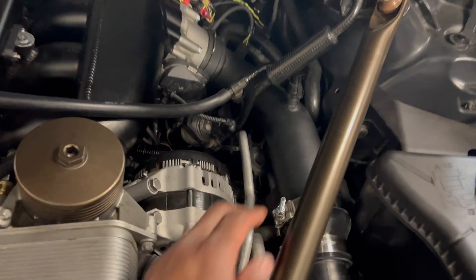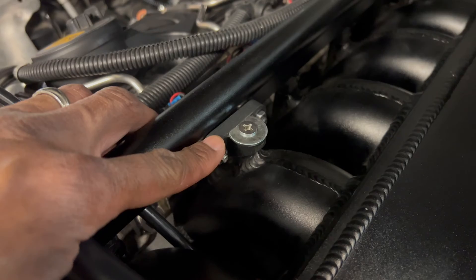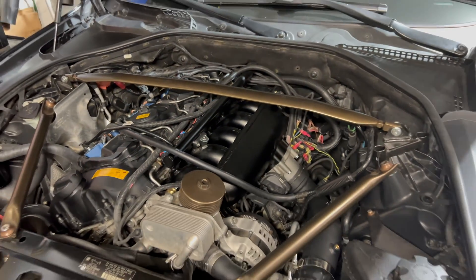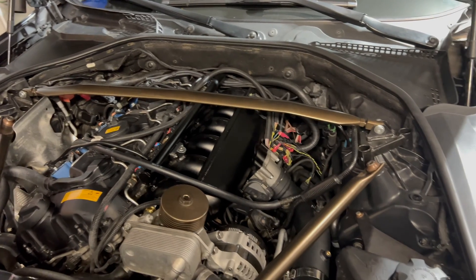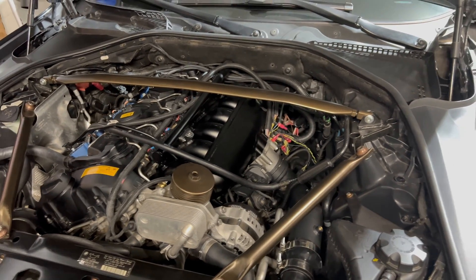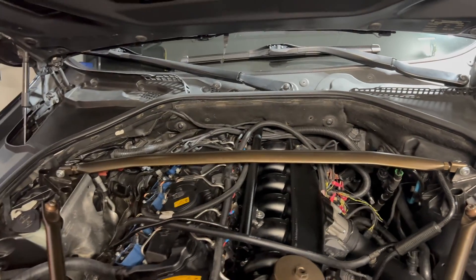It's been a few days. As you guys can see, we've got the new RVG charge pipe installed — we got rid of the temporary hacked-up charge pipe because of the fogger unit. Installation went great. These are now my brackets, as you can see — they've been 3D printed with nylon and they actually have metal inserts as well. I've got some washers I modified just to make sure we keep that fuel rail in position the way it needs to be. That is our final installation. I did a smoke test to make sure I didn't have any leaks at all, and we are back to boosting. Right now we're running roughly 23 to 24 PSI. David has been fine-tuning things, making sure the fuel map we're running with the Reflex is where it needs to be and tuning our long-term fuel trims. We're to the point where we're happy now, and really excited to start turning the boost back up on this turbo. Should be having you guys an update real shortly — I'm getting ready to head to the dyno for a nice E50 pull on the new Franken F55 turbo. You guys can see it hiding down there in the turbo blanket.